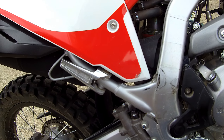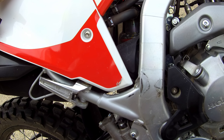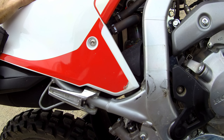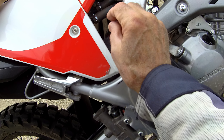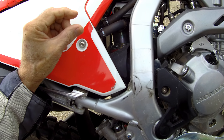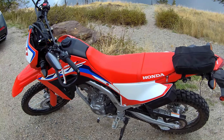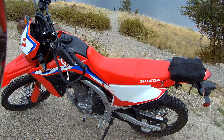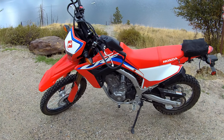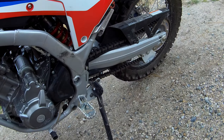I don't know whether you can see inside there to see the shock, where the adjuster rings are for the preload. If you can — I'm hoping you can — that is with preload maxed out, and you can see the width of the two rings, and then there's about two threads above that. So literally there's about this much preload adjustment possible. I saw a video someone else did and he was adjusting preload, and it looked to me like he maxed it out, but he said, oh no, it's got another three-quarters of an inch yet to go — and I'm thinking, what? Is his shock on the 300L different than mine? I don't think so. That's what mine is like — it's just a very minor amount of preload adjustment possible.